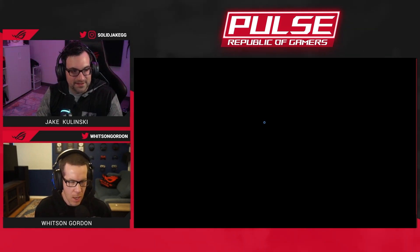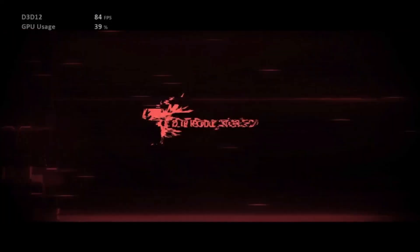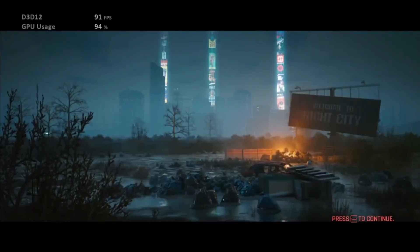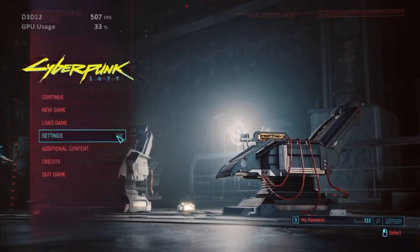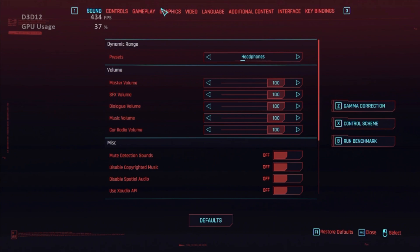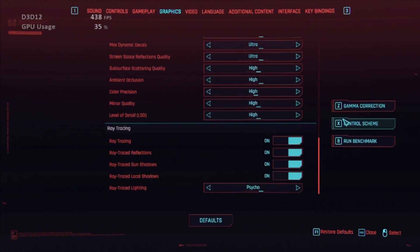I'll talk a little bit about the benchmarks I use. You've got to use more than one benchmark with a GPU. I'll show off Cyberpunk here, but I also ran a bunch of rounds of Superposition from Unigine — that's a great benchmark, you can run it in 8K and it will just peg the crap out of your GPU. Some people like FurMark — FurMark is fun if you want to test the maximum heat output of your card, but it's not going to test the maximum clock, so it's not always the best stress test for determining overclock stability. I'm running at ultra settings at 1440p ultrawide with ray tracing on Psycho.